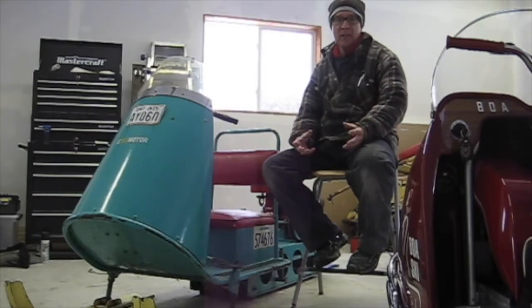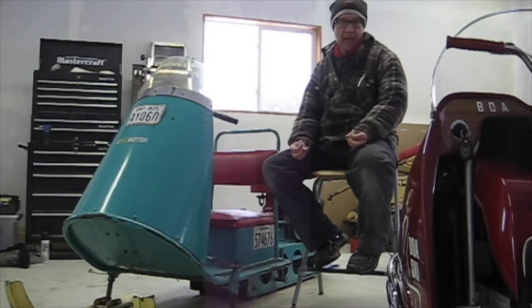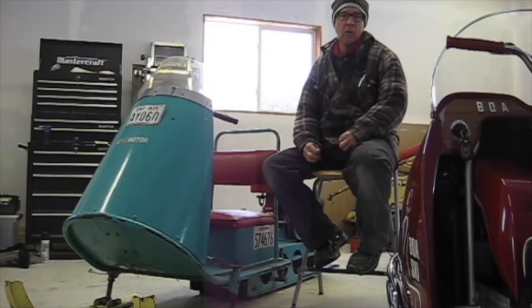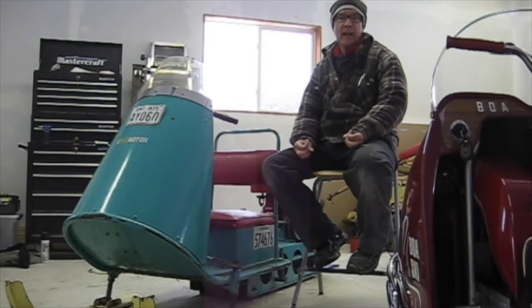So it's back in the workshop and I'm attempting to get it running. I've been able to get the engine running on a spray of gas. However, the gas line was plugged — the petcock had some material in it and was no longer operable. So what I've done is installed a sediment bowl filter and petcock on the tank, which is something that should have been done originally anyway.